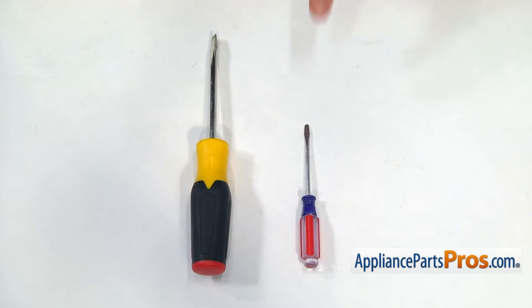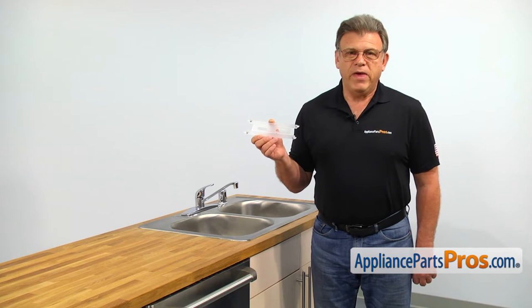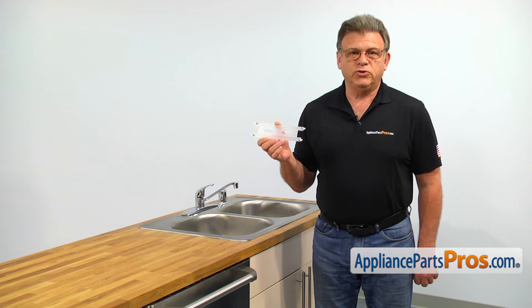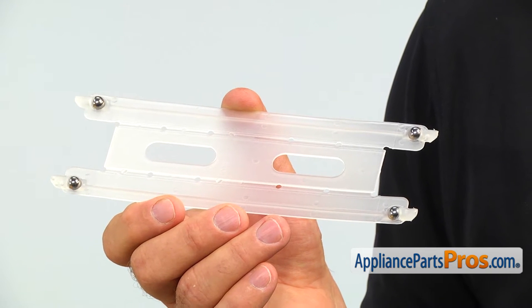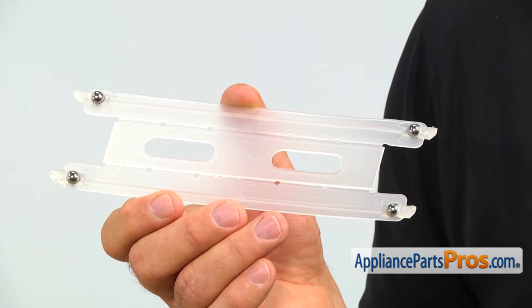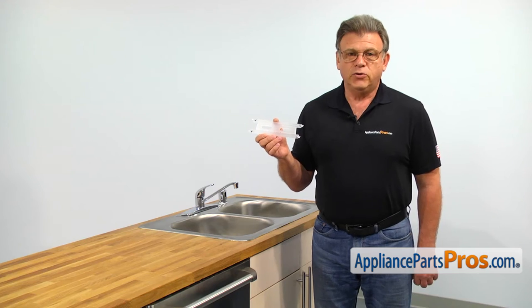For this job, we're going to need a small flat blade screwdriver and a large flat blade screwdriver. When we open up the package, you're going to get a new roller bearing cage. The roller bearing cage is located between the inner and outer upper dish rack slides and allows for smooth movement of the dish rack when it's fully extended. The main reason why a roller bearing cage would need to be replaced is if it breaks and the ball bearings become loose, causing the dish rack to jam.